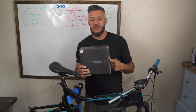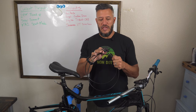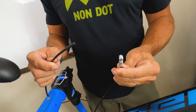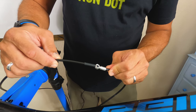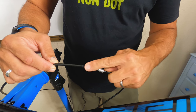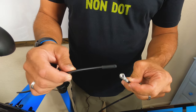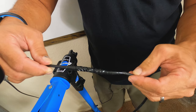Here's the brake we're going to be putting on — this is the Shimano XT BR-M8120, four-piston XT, awesome brake. The way they ship the brakes now is it's not all one piece — they don't have the brake line attached to the lever itself. They have this little plastic on the end of the cable, so this is filled full of brake fluid, and the lever is in the box as well with a little plug so the brake fluid inside the lever doesn't leak everywhere. What we're going to do is hold them together and use electrical tape to tape them so it's pretty much one continuous line — so when I pull this cable through the bike, it'll pull the new brake line through as well.